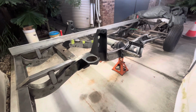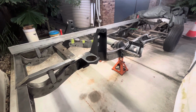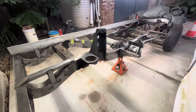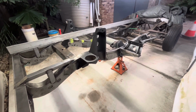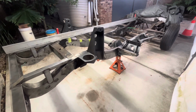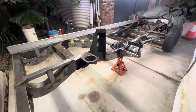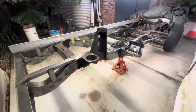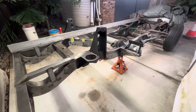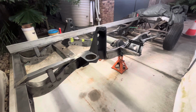They are in side elevation and plan view, so that's looking from the side and then looking from above. Each chassis has the diagrams, and then the following page is the measurements. There's reference numbers on the diagrams, and then you reference those to the measurements that they should be. There may be a case in one of the workshop manuals, I think, where the 90 diagram and the 110 diagram are switched around by mistake.